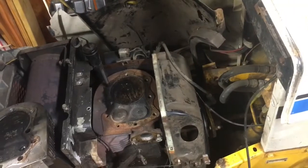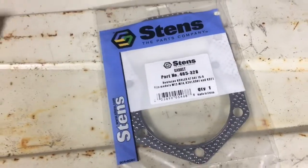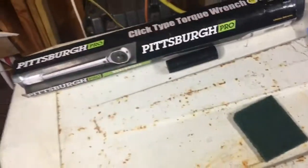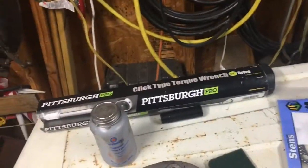First, you're going to want to get a Brillo pad. Here are the things you're going to need: of course your head gasket — it's like nine bucks, not bad. The Brillo pad is to clean the bottom of the head. You're going to need a torque wrench and the socket for whatever size head bolts you have. I'm also going to put the head bolts back in with never-seize so they don't get stuck, and then of course you'll need your head and the head bolts. Always remember safety comes first — you don't want to get that stuff in your eyes.